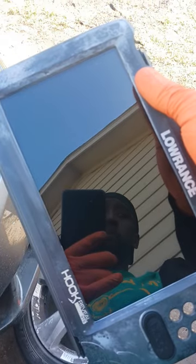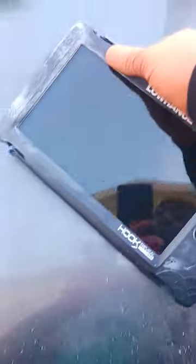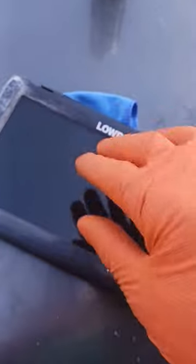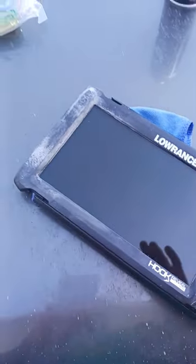And I can say, if you are putting that B7000 glue on something in a screen like this, pile it in the middle first. In the middle of the screen, and let it spread itself out. Because one thing that I did do, I put the stuff everywhere on the screen, and when I got ready to lay the LCD on top of it, it had air bubbles everywhere.